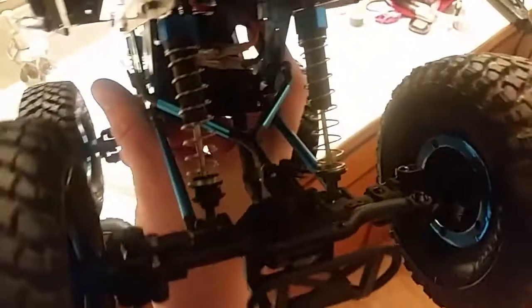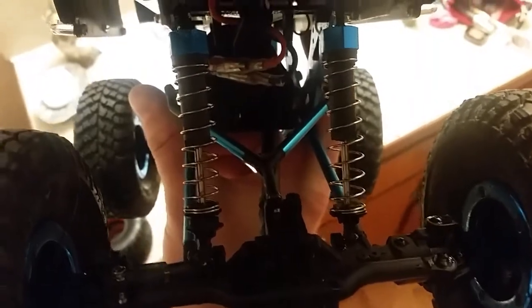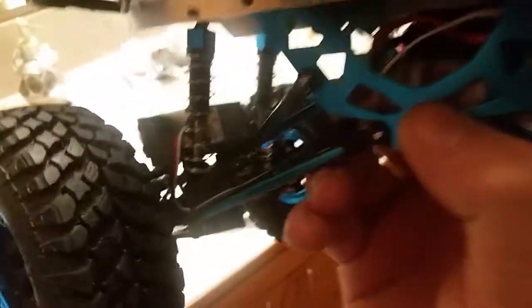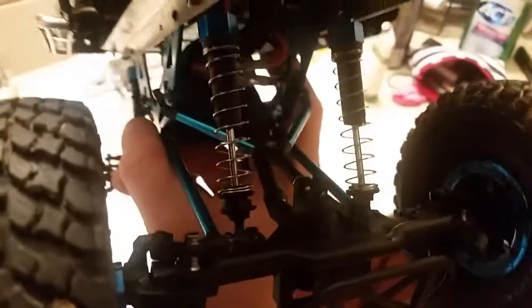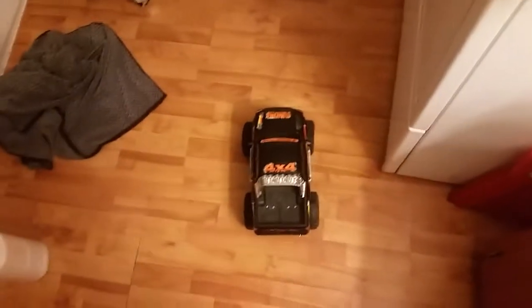All of the shocks on the bottom come with those little cups that hold the spring in place on the bottom of the coilover. I had ordered earlier a couple of extra coilovers because I needed to replace one. I decided to pull one of those little cups off and add it to the left side — so basically both of my left side coilovers now have those spring cups. Just doing that compresses the spring a little bit more, and it has greatly eliminated the torque twist I had.